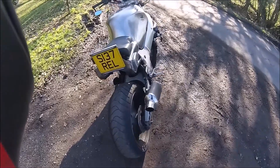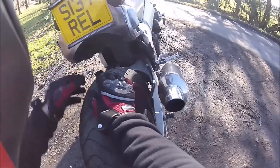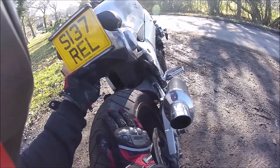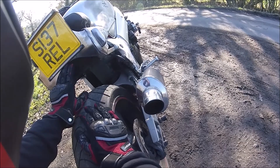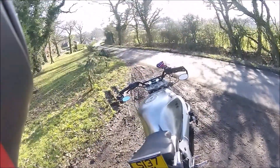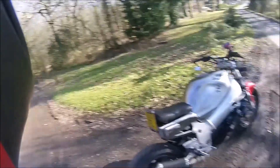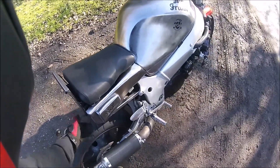I am an amateur and the fit isn't perfect, but it's pretty darn good. I've definitely done that high enough now — the tyre's not hitting it. Before, it was just knocking the light out, chewing on it a little bit. That's raised up about an inch, plus I've raised the suspension via the dog bones by about an inch as well. So it's given me a lot of clearance. I've hit some right old bumps today and obviously there's no damage whatsoever, no chewing — so that's good.